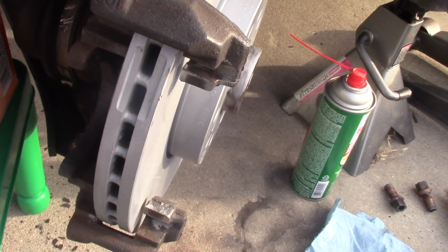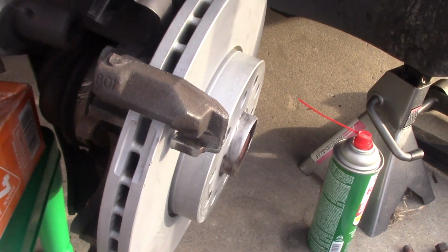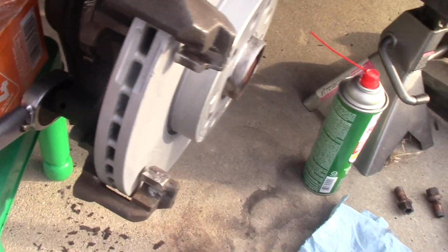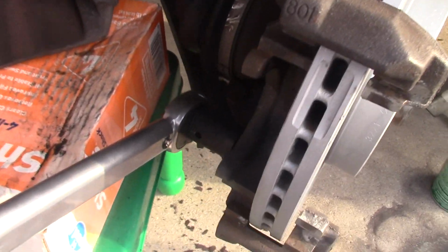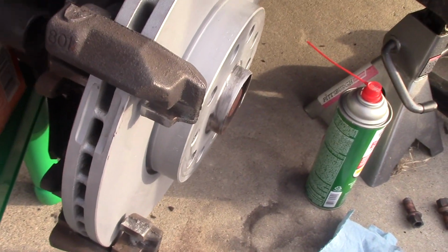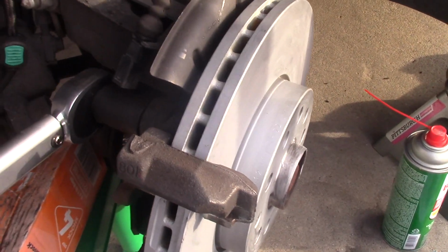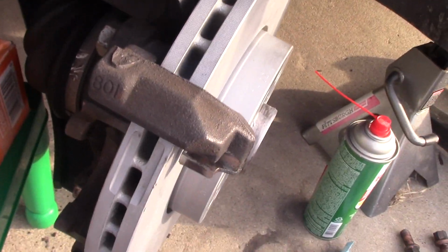I put the bracket back on, and I'm about to tighten those bolts and torque them according to the spec. It is 90, so you might have something similar, but look at your specification. And I'm snugging them, tightening them, and now I'm about to apply torque. 1, the bottom, and now the top. 2. Now it's ready to go.